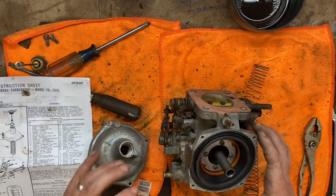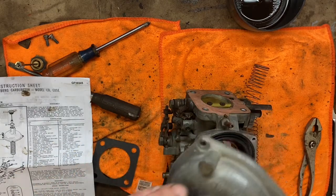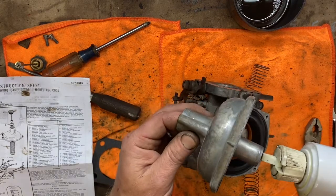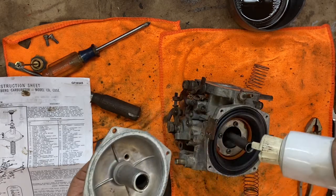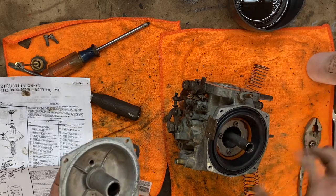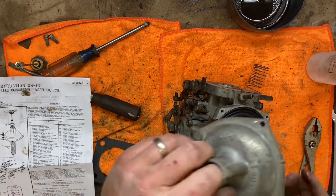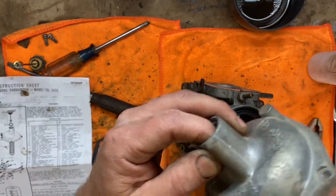Okay, I believe that they want to lubricate the outside of this rod for the fit into here. So, you know, this is basically an air tool. I'm thinking air tool oil will probably work. It does not specify, so we're just gonna use some air tool oil. Probably way too much. Put a little bit here, and rub that down with the finger. The rest of it's in here. Alrighty. I'm thinking that that's what they meant by that, so we'll go with that, and I'm happy.